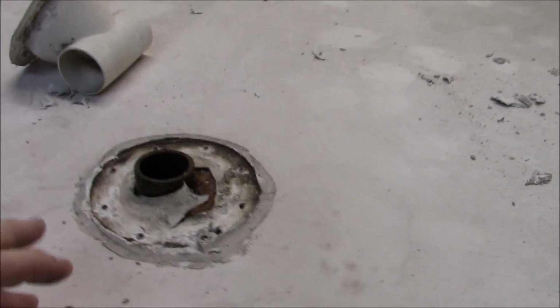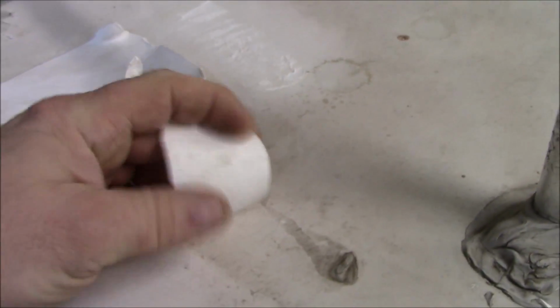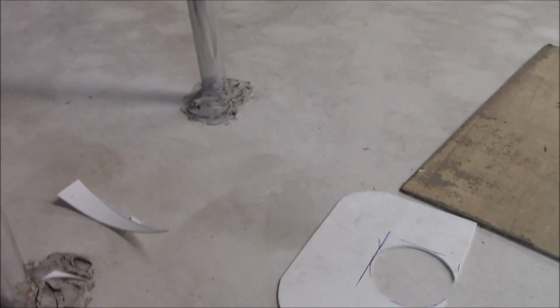That's about it. So what I did the other day, took all this apart because I needed to get a piece of this to see what the material was, and then I tried to do some sample welding, and you can see it didn't take. And he thought it was GAF, this is GAF right here, and I welded it right here, and it peeled right up. And the same with this, this is Carlisle right here. Typically the back of the Carlisle is black, and then on the GAF it's a dark gray. And then they have another one that's a light gray, that's lighter than what is on here. Nonetheless, it doesn't want to weld to it. So that's where we're at with that.